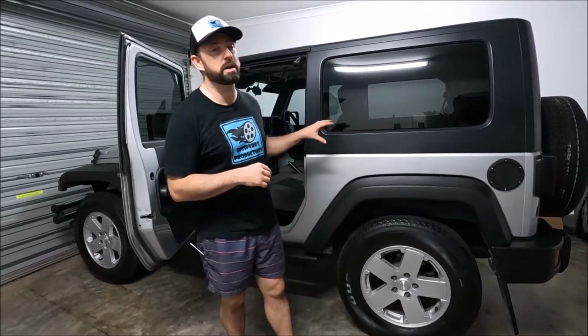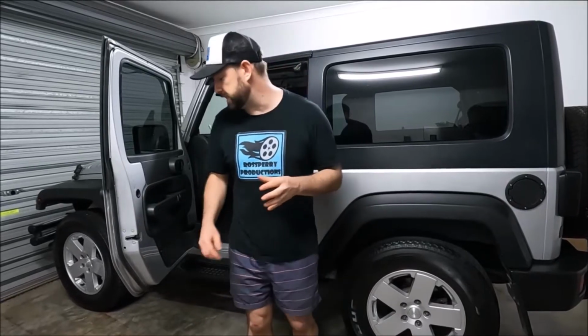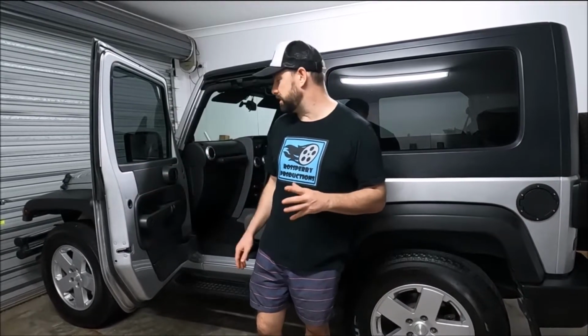This is now the 15th video I've actually made on my 2009 Jeep Wrangler, and in this video I'm going to be showing you how to remove and replace the door panel or door card. Now the reason you may want to do this is to get to your door locking system or also the electric window system. So relatively easy to do, and all we're going to need is one number 2 Phillips screwdriver. So I'll show you it right now.